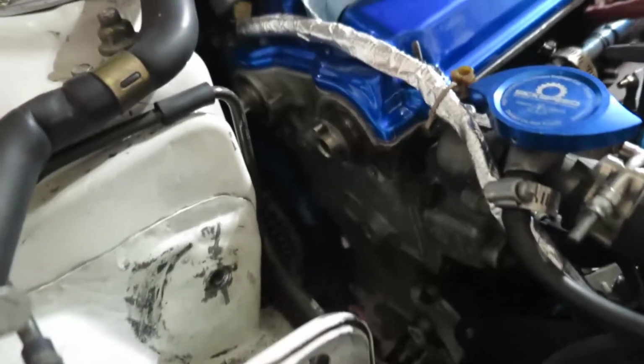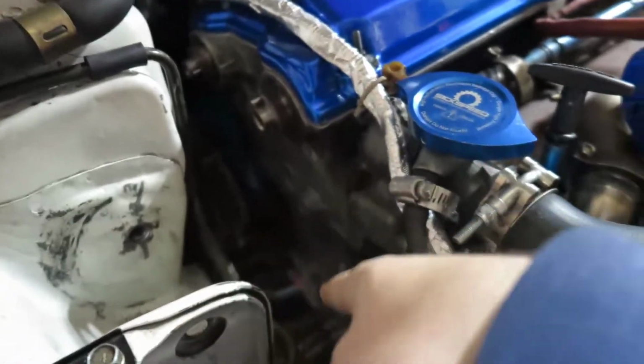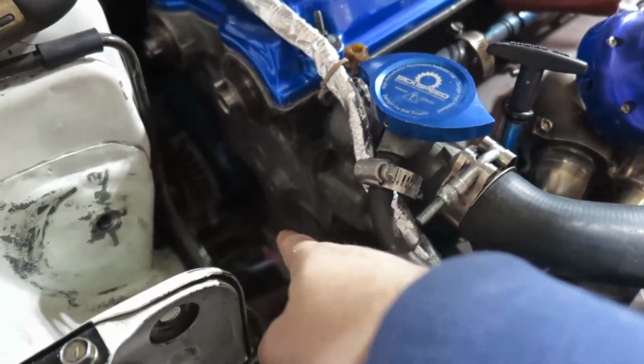Okay, so now it's 2021 already, and you already know that I was hearing a knock. We're gonna take stuff apart. You saw some on the first video, but I'm gonna show you how to take everything apart and get to this state here without taking the engine out of the car. So you see the timing belt's not there, sprockets are not there, oil pump is gone, tensioners are gone, everything is gone, and it's everything up here.